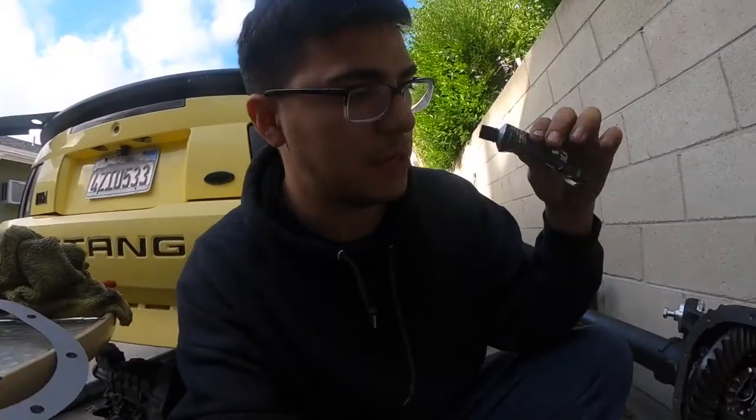today. It will be installed tomorrow, just because I am gonna let the little black gasket maker sit overnight, and then put the fluids in tomorrow, because superstitious, don't want anything leaking through. So I want the best seal I can get. So I'm gonna go ahead and let it sit overnight, and then we'll install all of this tomorrow, and this should finalize the rear end install video.